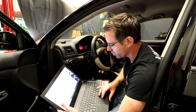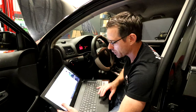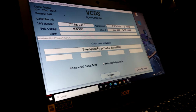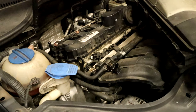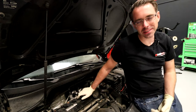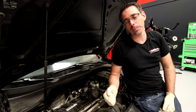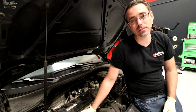We've already erased our faults. We're going to go into the output test to actually actuate the evap purge valve. In the sequential output test it scrolls through all of them, with the evap purge valve being first — you click activate and you should hear it clicking under the hood. That test shows us the valve is actually working, though it doesn't tell us if it's flowing properly. Given our situation it's likely intermittently getting stuck open due to carbon buildup.